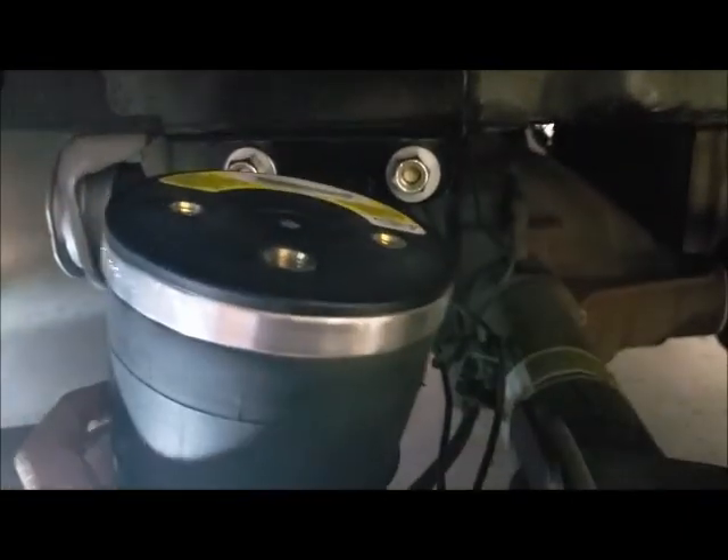You're not going to tighten it all the way up — keep it pretty loose. Finger-tighten these, because when you set your truck down that's when you go ahead and twist everything around. You may have to move this bag forward to get it all to line up. It also comes with a shock extension. This is all on the driver's side — the shock extension goes right there because your airbag will be rubbing against your shocks.